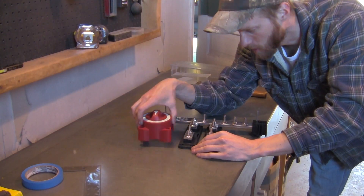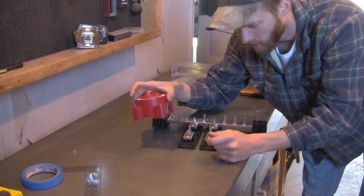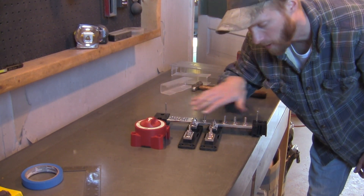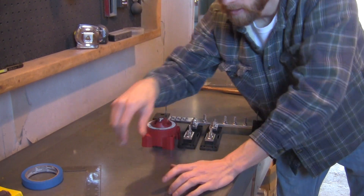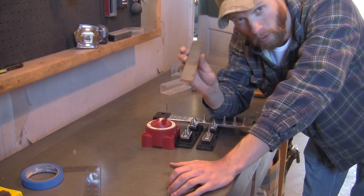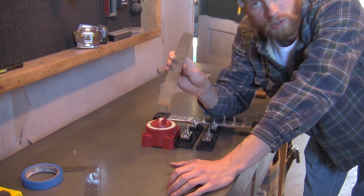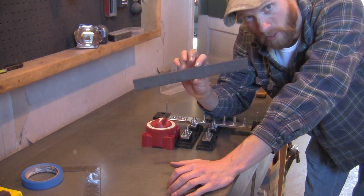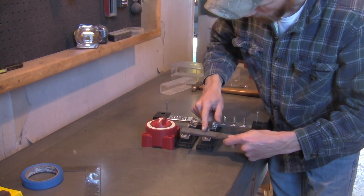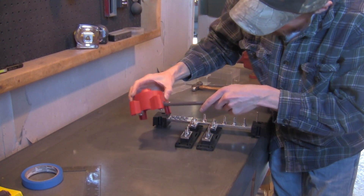The main disconnect switch is going to have power coming in and then a stud out that feeds the main fuse, which feeds the bus bar. Instead of buying a cable, I'm using a piece of copper - inch and a quarter wide by quarter inch thick - from an industrial salvage yard, same place I got the angle for the battery hold-down. This piece of copper cost me five dollars. Cut it to length, put two holes in it, and it connects here and here.